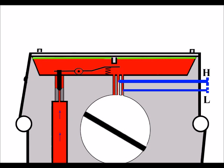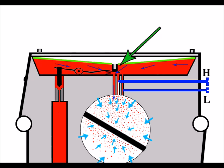Another problem, however, we can be faced with is problems with the diaphragm itself. This diaphragm's made from special material to allow it to be nice and free and flexible to move up and down nice and freely, covering a good distance there. And it needs to cover enough distance so that this part of the diaphragm here, the dowel area, lowers down enough to push down here on the back of this lever, the metering lever. And when it does, we get this.